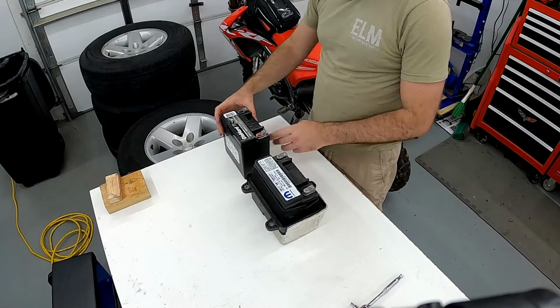Okay, back over at the vehicle, obviously hook up your battery connections. Then we're going to slide the tray back up in there and put the bolts for the battery tray back in. Okay, so these fasteners are actually a plastic rivet. And then these down here, like I said, were the Christmas tree style clips.